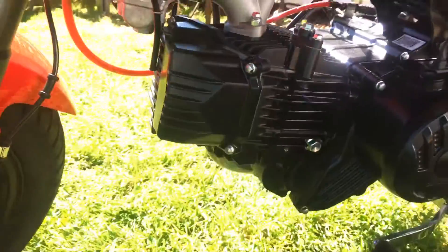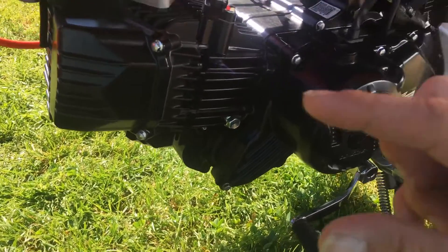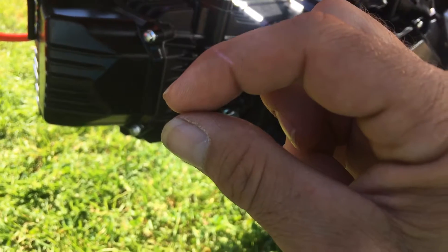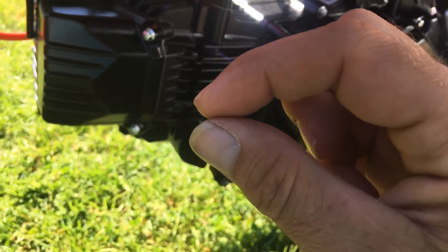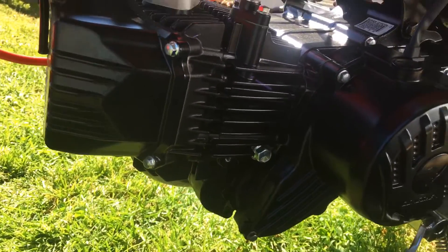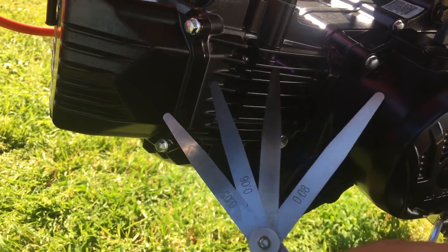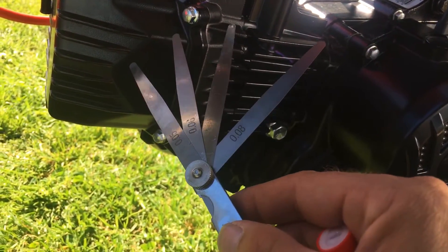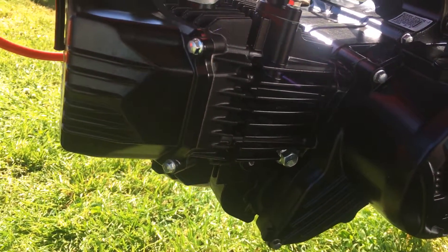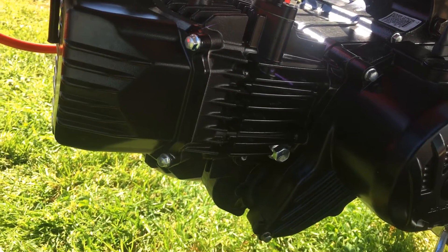What you're going to want to feel — grab a piece of paper, put it between your fingertips. Take your fingers like this, put the paper there, don't squeeze hard, just touch your fingers together, then with your opposite hand pull the paper out of your pinched fingers. Get used to that feel, because that's about what the tension should feel like when you have your gauge under the valve. You can move it back and forth to feel the tension, and slowly pull the feeler gauge out.